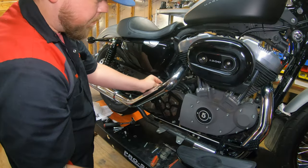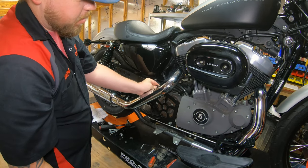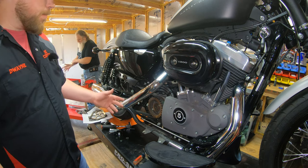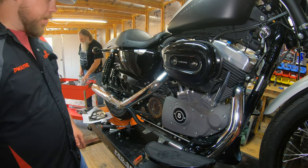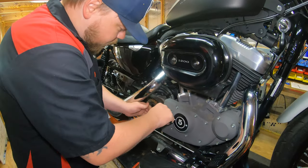You can see if there's a metallic gray back there it'll look real nice turning over behind that cover. Now this pulley is one of the few things on this bike that's going to get a little corrosion on it. We're going to get that off before we hit it with a light coat of paint — basic wire brush, same way you clean your grill, and just go to town on it.